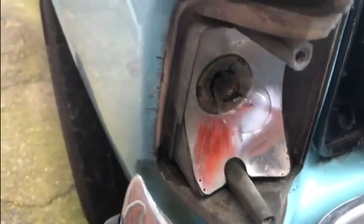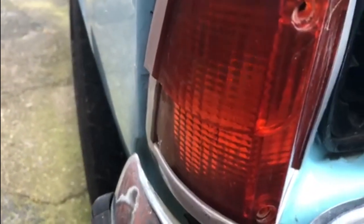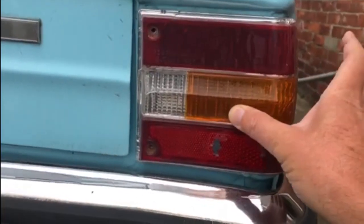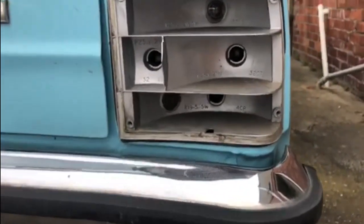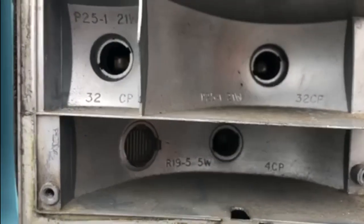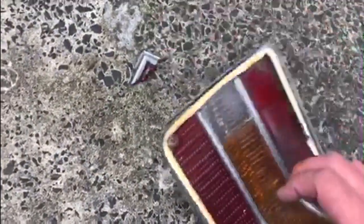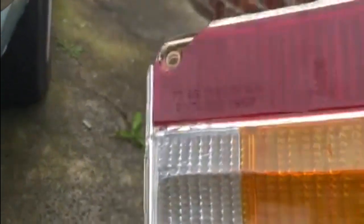Can't see that being very bright to be seen from the road. Let's put the lens on and find out. Well, it's working, but it could be brighter. That front indicator's working. So, with all the screws out, let's get that lens off. Well, I wasn't expecting that. That'll be the reason why most of the bulbs aren't working. And I've just noticed, when I've taken the lens off, part of the lens has broken off at the top as well. Now, obviously, these are 48 years old now — you can see on close-up all the fractures and cracks in the lens.